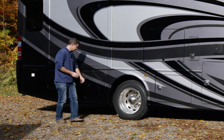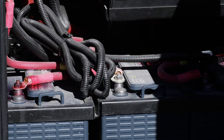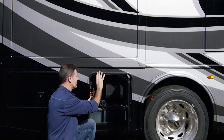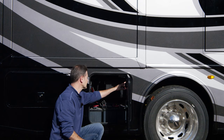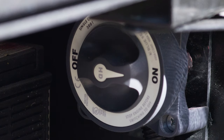As we walk down the side opening this bay — all of our batteries. These are all connected together. As we were talking about with your battery disconnect switch, when you turn that to on and leave it on, it's going to run all of the power into your coach. There's also a circuit breaker back here — if something's tripped, you can reset that. This rotary switch here is a disconnect switch for your chassis battery. If you want to completely disconnect your chassis batteries, turn this to off — great when you're storing your motorhome. But remember, if it's not starting when spring rolls around, come out here and turn it to on, and that'll likely fix the problem.